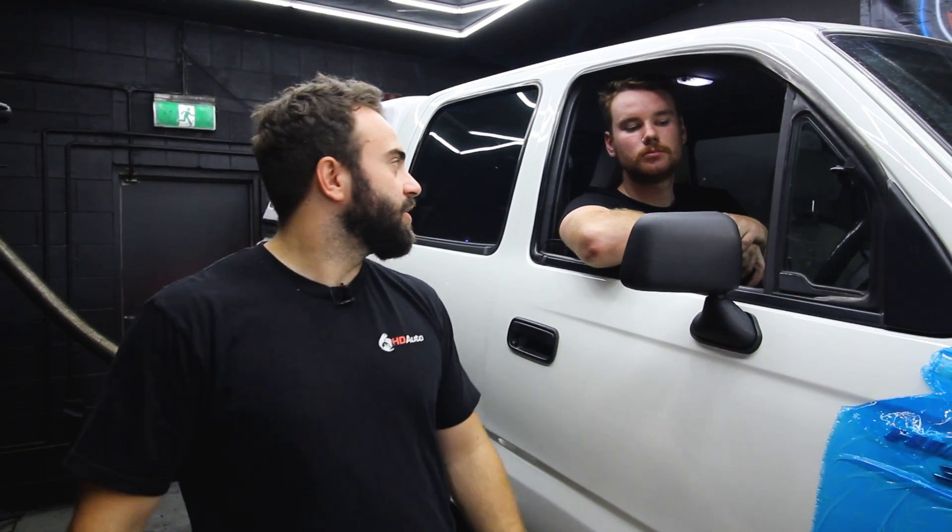So we're going to start today with a base run — nothing's been touched yet. These normally make around 60 to 70 horsepower, with the turbo added in stock form maybe around 55. I've seen them as low as 36 horsepower with no turbo on them. We've already picked up a little performance just by adding the turbo, but now we're going to tune the car and get our optimum result. We want to see around 100 horsepower at around 15 psi boost and a 20 to 1 AFR.